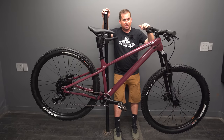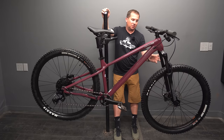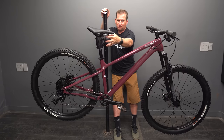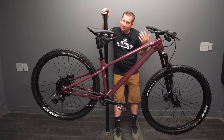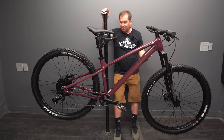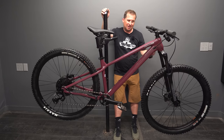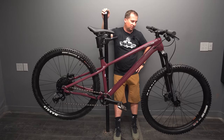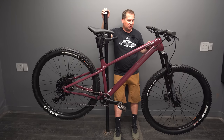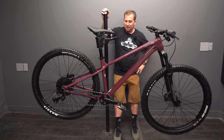We'll see how it rides, but I feel like coming with the Judy is a bit of a shortcoming. Coming with the 120 mil dropper is a bit of a shortcoming. Granted, it's a $1,450 bike at time of filming. That's still pretty impressive for what you get. But I don't know, anyone over 180, I think you're going to find this 32 mil fork lacking. I've got kind of a knocking in the front end. It feels like a loose headset. It's not a loose headset. I think it's the fork. We'll see how that plays out.